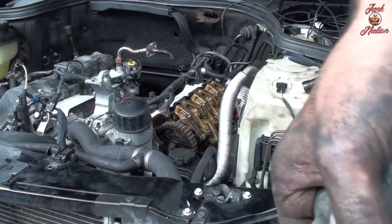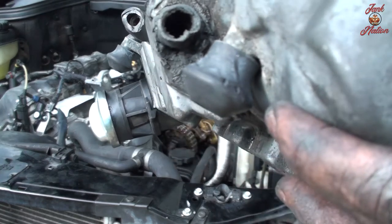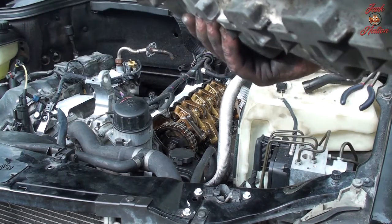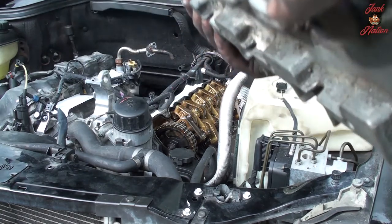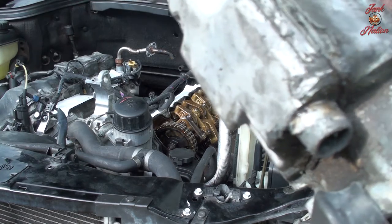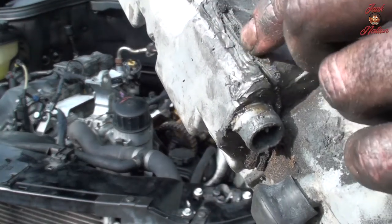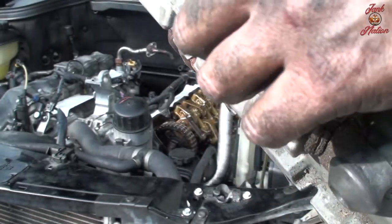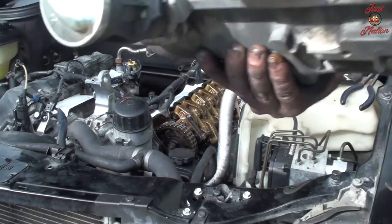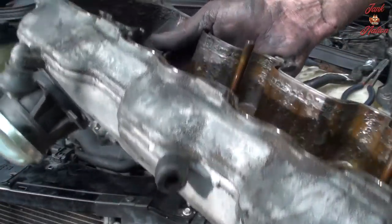That's unfortunate. Look at how deformed it is. That's pretty deformed. This is metal, okay? This isn't plastic. I mean, it's not like a grate. I think it's like a pot metal. But something happened to this. There's corrosion. Somebody at one point in time poured something on this. I want to say muriatic acid. Someone poured muriatic acid on here to clean this motor up, and they left it on, and it started pitting different parts of the metal.